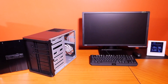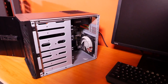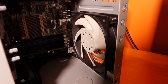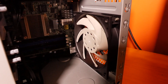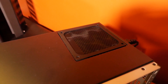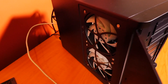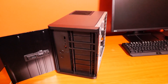The system is complete for now and ready to boot for the first time. Before I hit the power button: this fan I had as an intake is definitely supposed to be an exhaust, so I've turned it around. We now have one 120mm fan as an exhaust at the back, an 80mm fan as an exhaust on the power supply which won't run most of the time, and two 120mm fans as intakes on the side drawing in cold air for the hot swap bays and hard drives. That's how this case is designed.